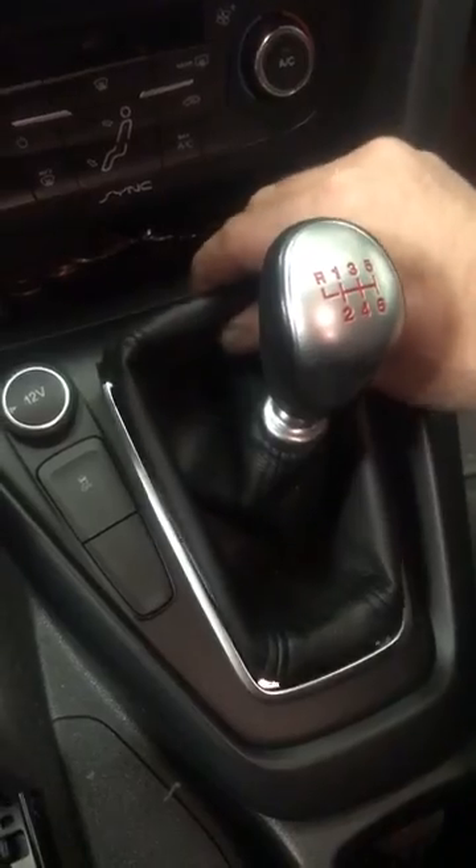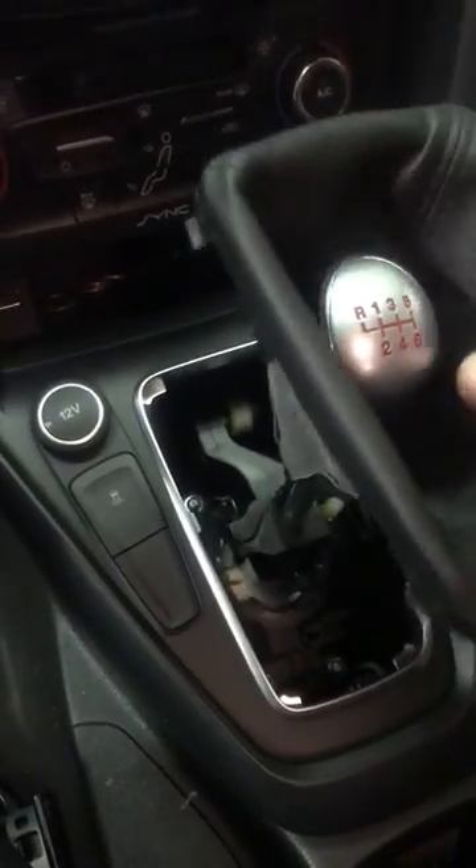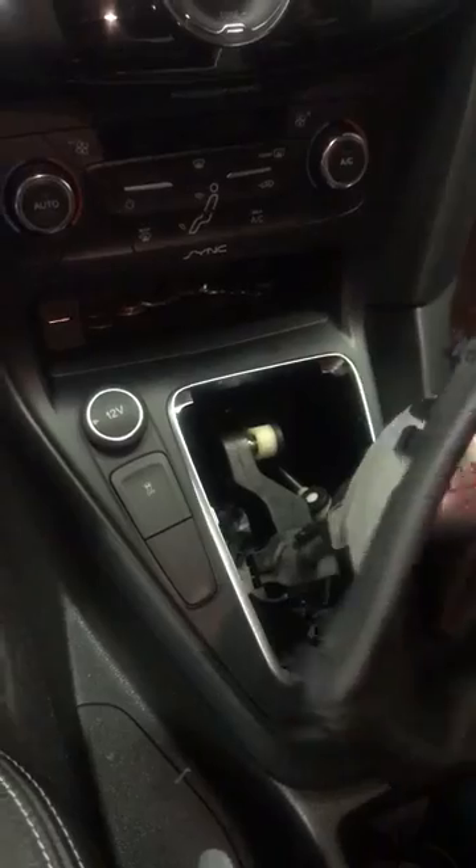So I looked around the internet, wasn't able to really find anything, but what I found on this car after just looking at it real quick — you can see here for the side mechanism, there's a bushing right there that holds the cable. That one is intact and looks fine. But for the forward and rear throws, it's difficult to see and difficult to get the camera in focus, but the bushing fell out of that little clip back there.